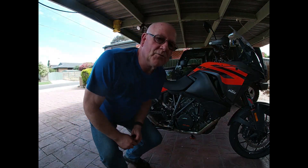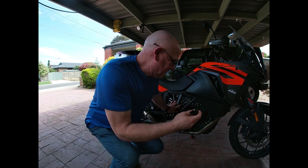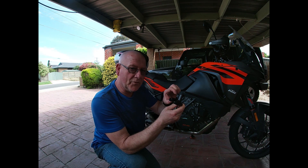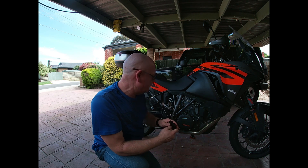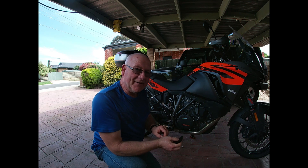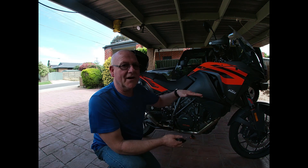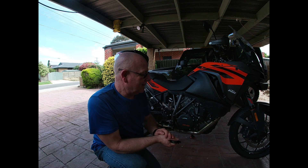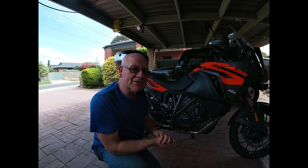So anyway here's what I got. It's a lowering kit. It's aluminium and what it does — I don't know if you can see the spring in here — it's a big thing similar to that but much bigger at the bottom of the spring. What you do is replace it with this one and it shortens your shock, so it drops the bike by about 20 mil. I'll bring the back end down a wee bit, and obviously whatever you do to the back you do to the front, so I'll lower the front forks by 20 mil — just adjustment, slack the four bolts off, drop it down 20 mil, tighten it back up, and we'll see how it goes.